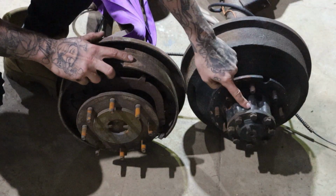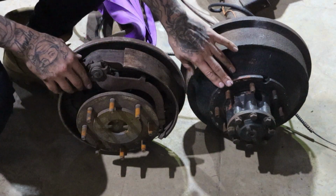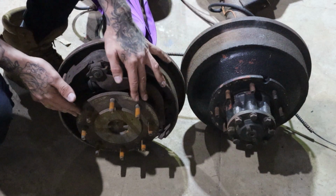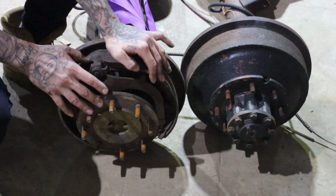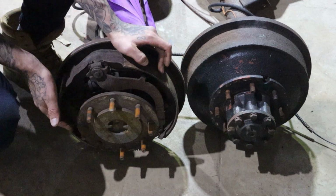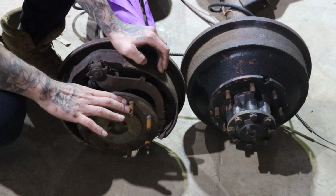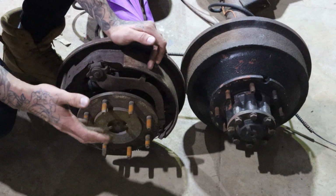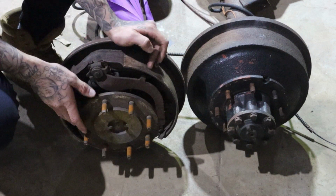Now, we'll duck down to the Dana 60 and I'll show you what a semi-float is. Like mentioned, this is full float and this is semi-float. You can see that your stud will be on the inside of this hub drum which goes over, and then this one here is actually on the axle with your hub on here. In America, they basically say semi-float is good up to a 35. After that, you need to start looking at full float. These are still usable, and people still run them on a lot of custom diffs in the States, but in terms of what you want to upgrade to, full float is where you're at for weight bearing and the race bearings.